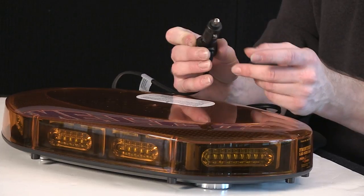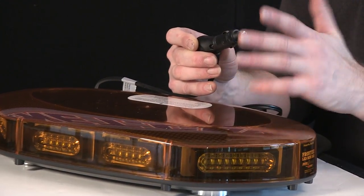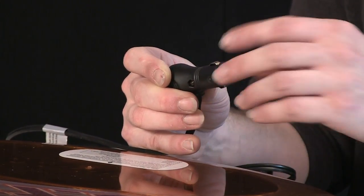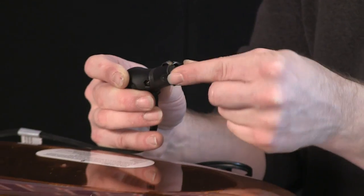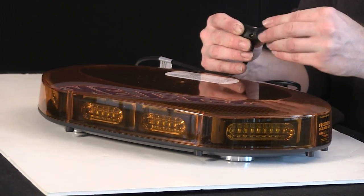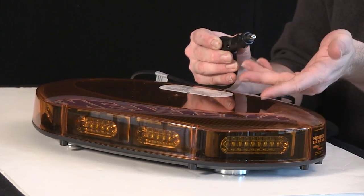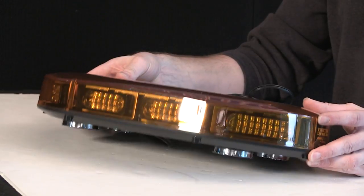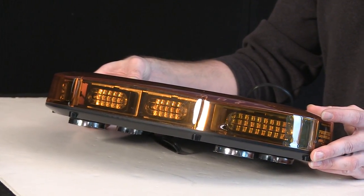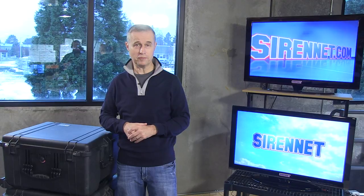Also, with the unit, incorporated into the 12-volt cigarette plug is an integrated switch, so it controls the on and off. And also incorporated into the 12-volt cigarette plug is an integrated fuse. So if you ever have a day where you fire up the mini bar and it's not working, everything seems to be in order — go ahead, unscrew the cap and double-check the fuse inside to make sure the filament is still intact. The cap will screw right back into place — easy to service at any time. So there you have it, an inside look at Code 3's Frontier Mini Light Bar. I hope you've enjoyed the journey across the Frontier. Here at SirenNet Television, back to you, Stuart. Well, there you have it — the intrepid explorer Chris telling us all about the great product from Code 3, the Frontier Mini Light Bar. It's available here on SirenNet. Don't forget to check it out — the tech specs. Thanks for watching.